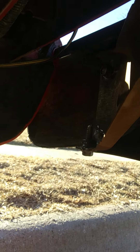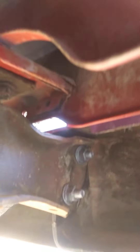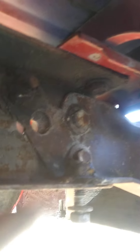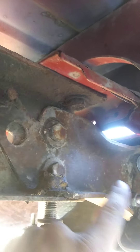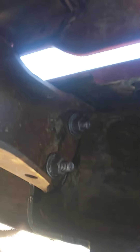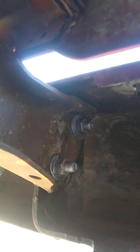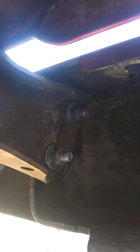Moving back a little further, here's the bracket. These are the bolts I was telling you about that you could undo if you wanted to, but don't take the bracket off — leave it on so it sticks out and you have something to set the bumper on when it comes time to put it back on. Just remove the two 19 millimeter bolts here. On the other side are the bolt heads — you'll have to hold those bolt heads with the box end wrench so they don't turn on you.